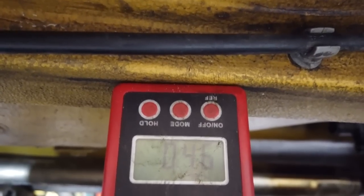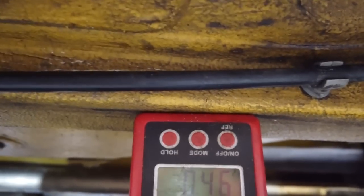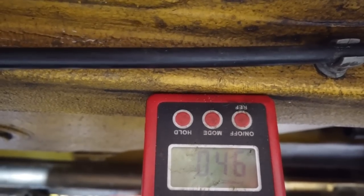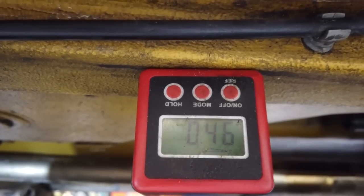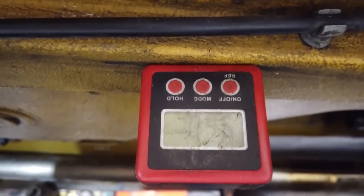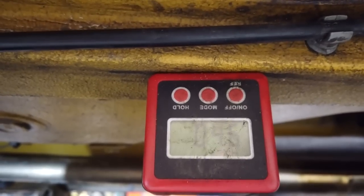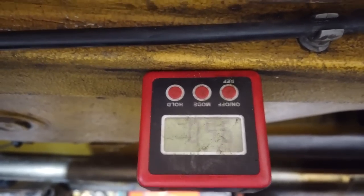We've actually got the front on axle stands. Really, all four wheels should be supported off the ground. So you would do this on a drive-on ramp, or you'd do it in a pit, or you'd block your wheels up, or you'd put four ramps under each wheel so that the car is under driving load. You could argue as well that you would put some weight in the car to simulate an extra passenger, because if you are right on the tolerance of your angles and then a passenger gets in, you may notice that the drivetrain angle, if it was right on its extreme, would then drift into the realms where you'd get the vibrations. So there is an operating window of opportunity.